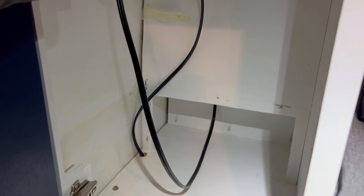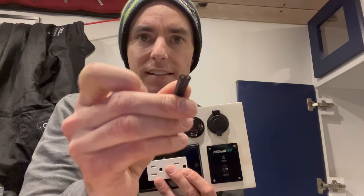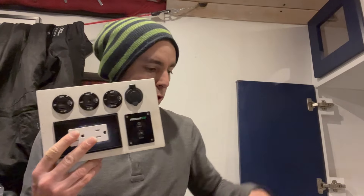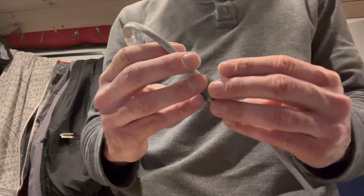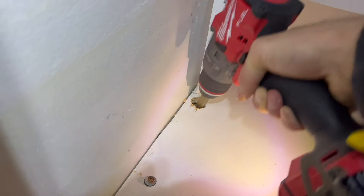This cable can handle 45 amps for the distance I'm going at 12 volts. I could run all of these off one cable, but I think I'll run these two groups each off their own cable in parallel at the end, with the little fuse holders they came with so I can fuse them individually and cumulatively. Biggest cable first - the one with the connector on the end - then two of the others. The AC cable is kind of snug but has room. I need to get that conduit into the piece of wood.